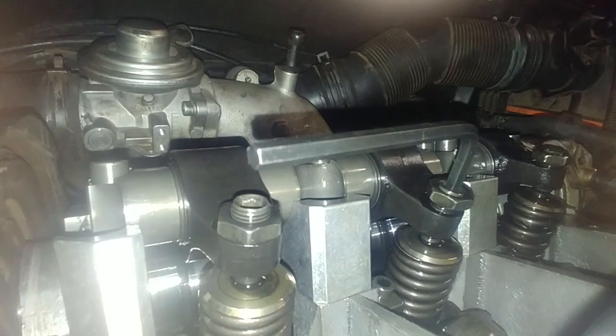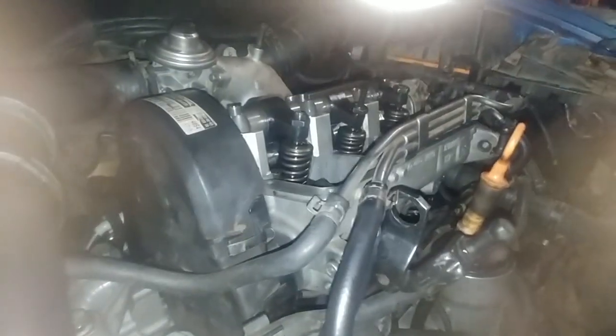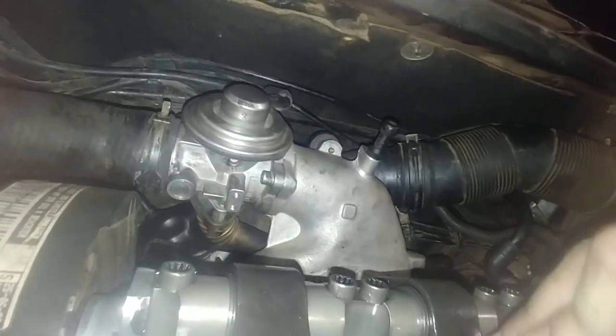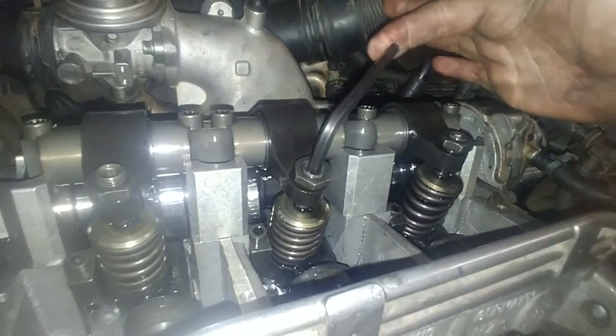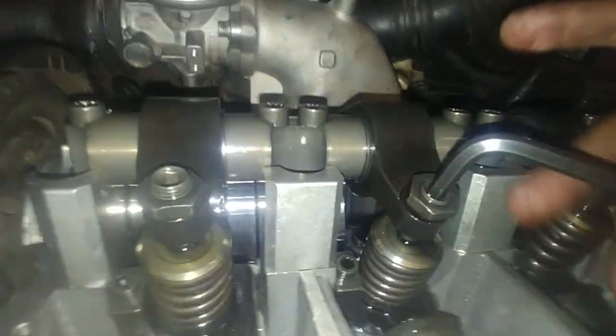Okay, right — about there. I think I've actually passed the high lift there, but the main goal is just to prevent the bottoming out of the injector — the concept still remains. That's past it. It's around about there. Rotate 180. Bottom out right there — there we go. So that's the high point. Rotating 180, that's just with the finger — just like that, and it stops. So that's the bottoming out point — basically full compression of the injector.